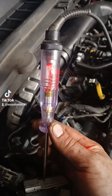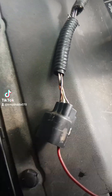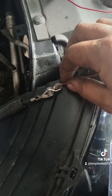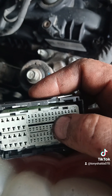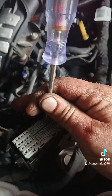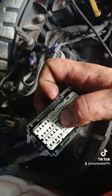I connected from here to there, but there was no continuity. I was certain that was the problem, but I moved on to the next wire. The third and final wire for that turbine shaft speed sensor is purple and green. I just pushed a piece of copper wire into the end of this, then clipped on to the other end with my continuity tester. When testing these, I'm not pushing my continuity tester into the rectangular holes — only into the circle test points. My purple and green wire is working, and it's the ninth pin on the second row. My only problem was the orange and white wire, which is the fourth pin on the second row.